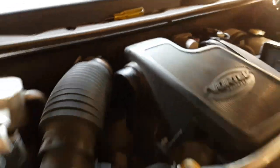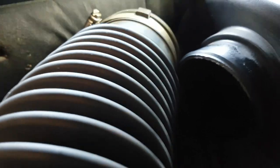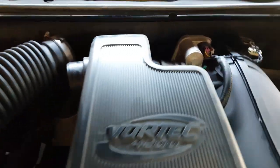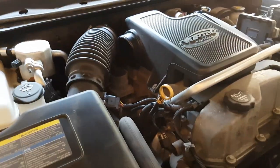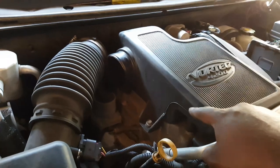For the interest of the video I'm not going to spend all my time unscrewing, but to summarize: there's one bolt here, the second one is here, plus the hose clamp, and there is also a hose underneath the resonator that you'll need to disconnect when you lift it off. I'll go ahead and do that now and come back once it's off.